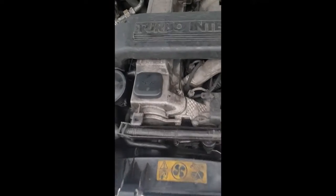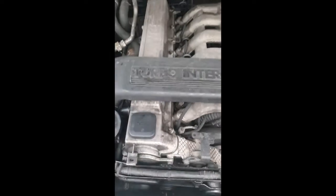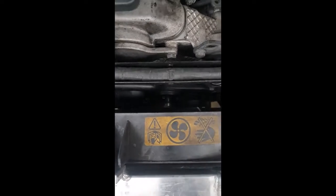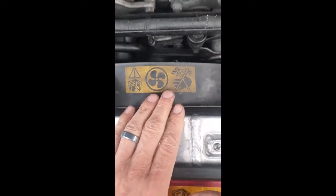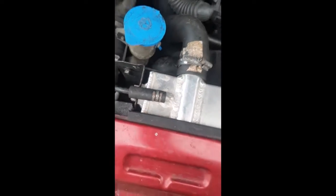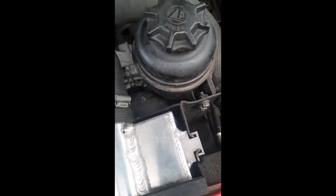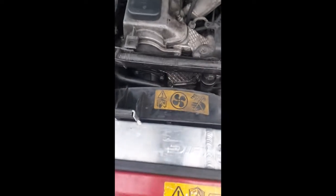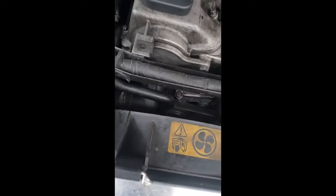On this one I haven't got the trims fitted — you'll probably have a trim to move from here which I believe is Allen bolts. Mine haven't been fitted since I've owned the vehicle. To get to the water pump we need to get the viscous fan out of the way. To get the viscous fan off we need to get the fan shroud off. To get the fan shroud out of the way we need to disconnect the radiator pipes. We also need to remove the brackets for the washer bottle and power steering fluid reservoir because the plastic body will not lift with those still fitted. There is a drain plug at the base of most radiators if you bother to use it — I'm not going to bother, I'm just going to disconnect the pipes at the top and make a mess on the floor regardless.